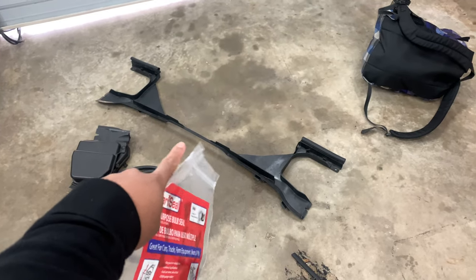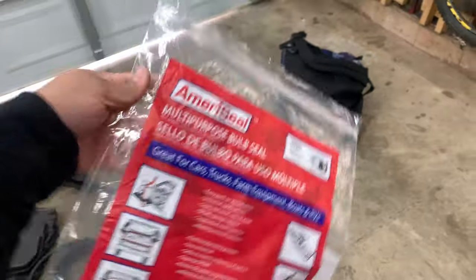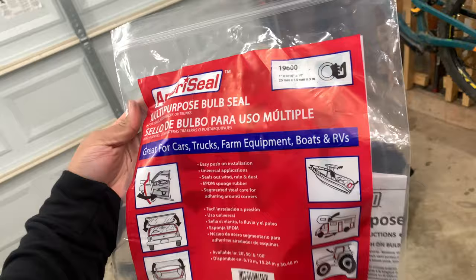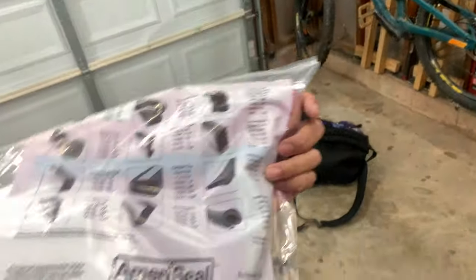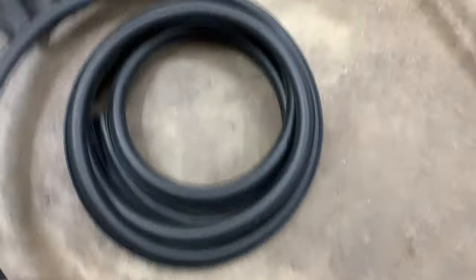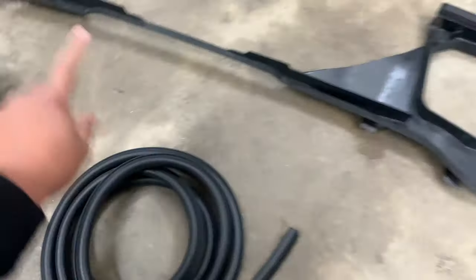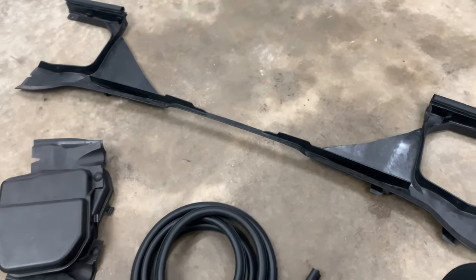So I took out the cowl again, and I bought this multipurpose weather stripping seal from Advanced Auto — there's the part number if you want it, I'll also link what I got in the description. I got the one with the steel core. It fits — I test-fitted it. Now I'm just going to cut it to size, make sure it fits on properly, and put you guys on time-lapse.